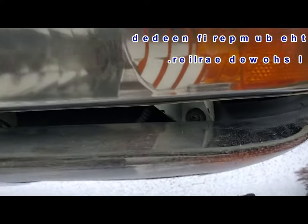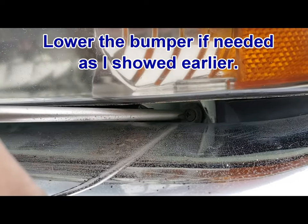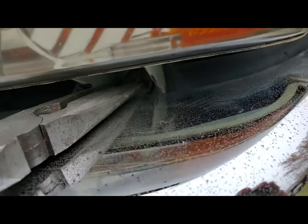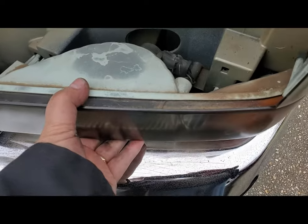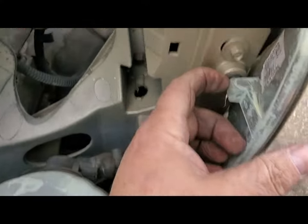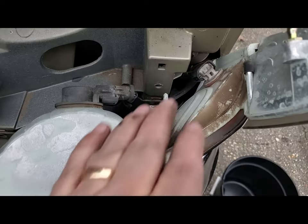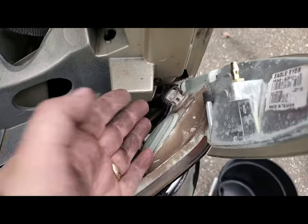For the lower section, there are two screws — one right here and one right there. Use needle nose pliers to keep them from falling. After you get those screws off, pick this up and give it a tug — it has little clips that hold it in, with little pins that go into rubber grommets. Give it a good yank and it'll come out. Use two hands so if you pull too far you won't snap the marker off.